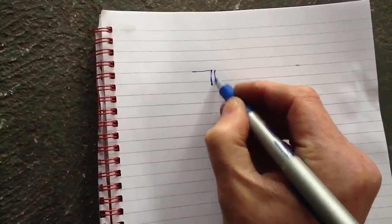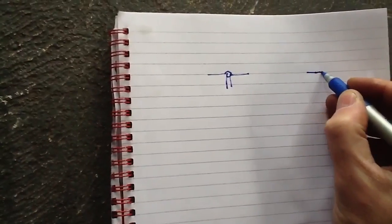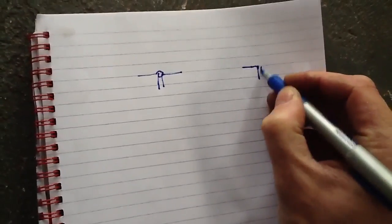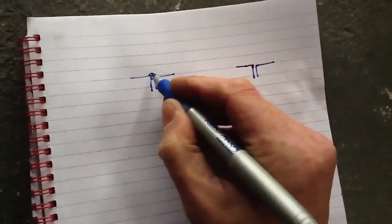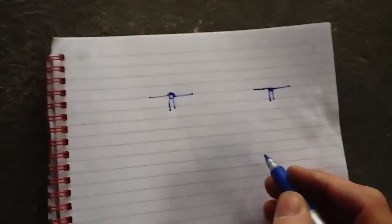There's the outer piece and the inner piece. And if I put a weld on here, it'll form like that. If I then grind down that weld to make it fit back on the bike, I'll need to remove this bit. So now it's like that. I get a very, very shallow weld.